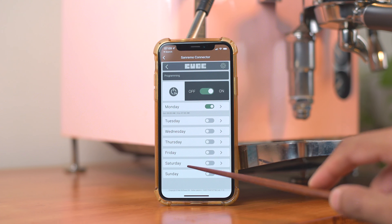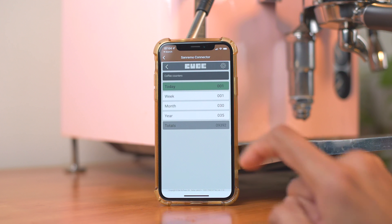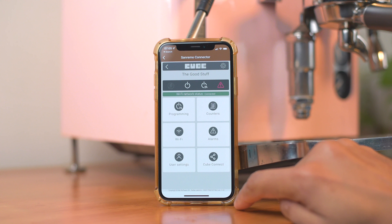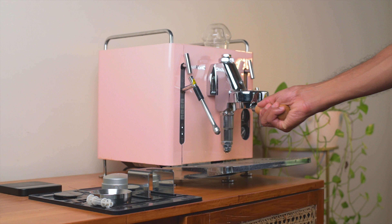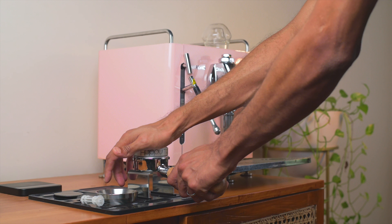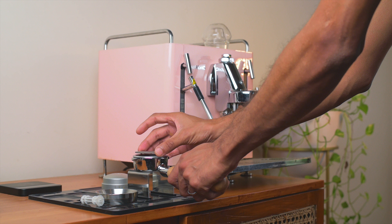The four icons on the top from left to right show you if the machine is on standby, if it's powered on, if you have scheduling turned on, and the last one is a warning indicator if there are any issues that need to be addressed. Below this you have some useful information like the boiler temperature, which you can actually set directly from here if you have the R model — but with the V it just displays what the potentiometer is set to. It even shows you the estimated brew temperature that the current boiler setting will give you. Next to that you have the water level indicator, which will call for your attention very often, courtesy the capacious water tank. You also have a filter health indicator, an extraction timer, and a daily count of cups you've brewed.